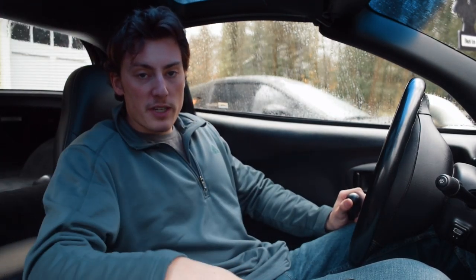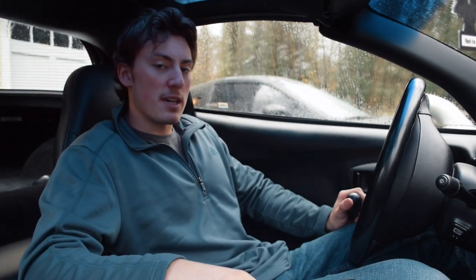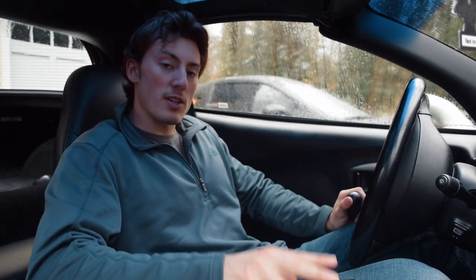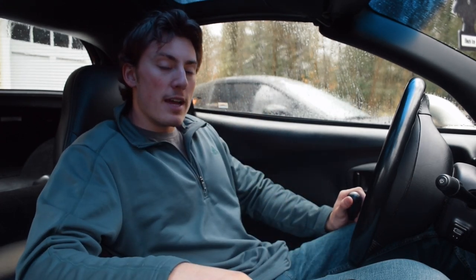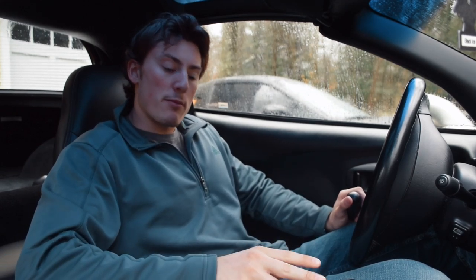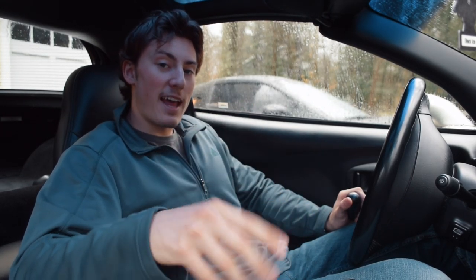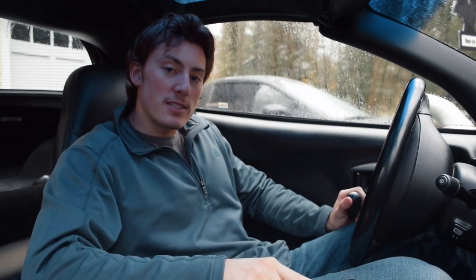So in that old video back in November or December, whenever it was, I took the shift knob apart, I took a look at it, I reassembled everything, making sure it was all tight, I went for a drive, and unfortunately, it still rattled. So what I did after, thanks to some of your guys' comments, was off camera, I took off the shift knob, and I went for a drive. And lo and behold, there was no rattling. So that made things nice and easy for me, and told me it was the shift knob.